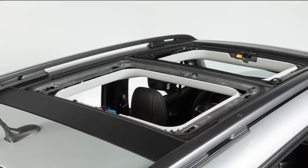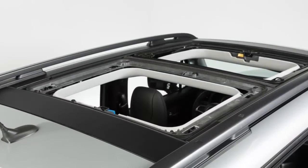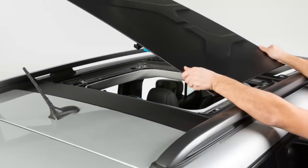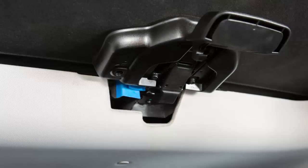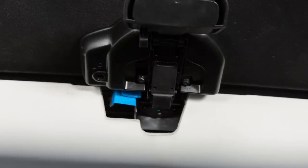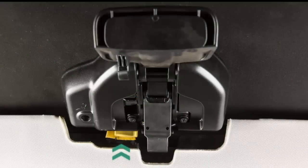To install the panels, you must start with the rear panel. From outside the vehicle, place the rear panel correctly on its track and gently align the panel with the colored guide tabs to ensure the panel is closed properly from inside the passenger compartment. The rear panel is labeled with blue guide tabs and the front panel is labeled with yellow guide tabs.